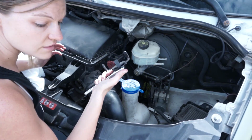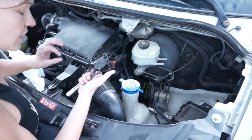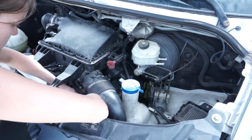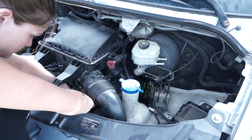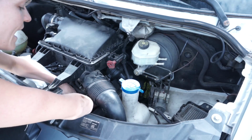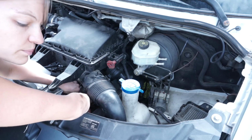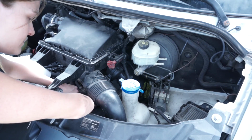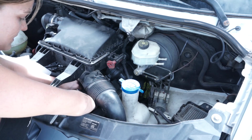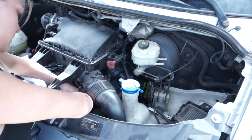I couldn't find one that was actually 84 millimeters, but I found this adjustable one that goes up to, I think, 94 millimeters. So this should work. I'm just going to stick that down in here and get that adjusted down on here. Not a whole lot of room to work down here, which is why you need this cap style oil filter wrench rather than the typical adjustable belt style that you often see, because there's no room to work down here, so you can't get that belt to tighten up. I'm only getting maybe 1/8 of a turn on this, but it is turning.